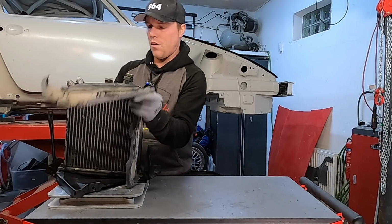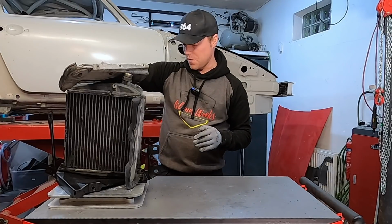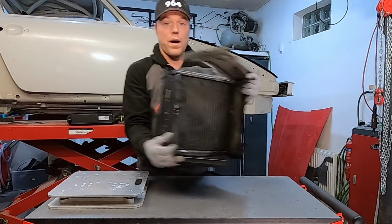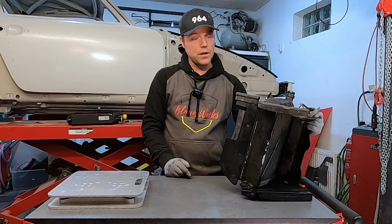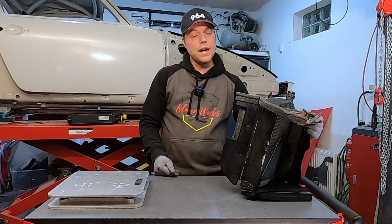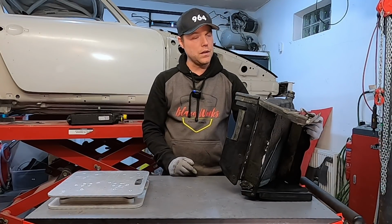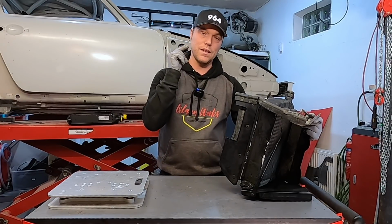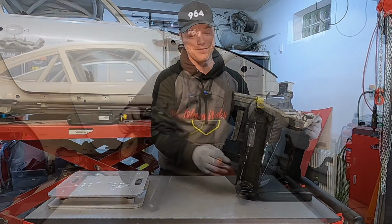And this whole contraption is just about 6.7 kilos. So it is quite a beast, this one. I also did a little bit of cooling calculations, selecting different coolers, looking at what they can do. And the challenge I have for myself is I want to have a symmetric, good-looking setup that gives me roughly twice the cooling capacity of this at less of the weight. Let's see how we get that done.